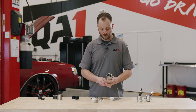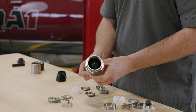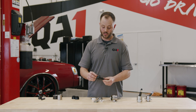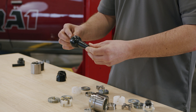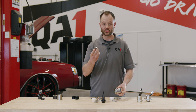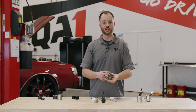From there we've got our ball joint stud, castle nut, and washer. Pulling the ball joint stud out itself, we can see there's an oil slot grooved out into the ball. This helps keep grease traveling around the ball joint. Internally we've also got a steel race, which is designed to keep the loads on the ball joint and keep that stud tight inside of the housing.